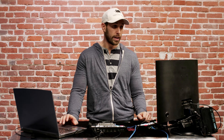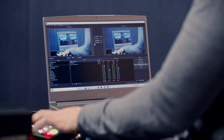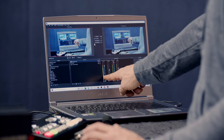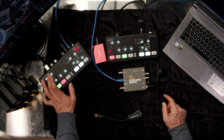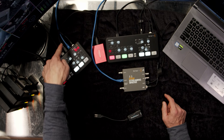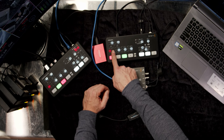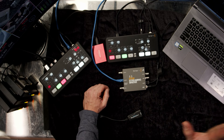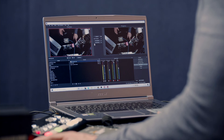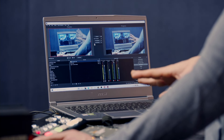One thing you might notice is that you're not seeing the audio come in. It does — audio comes through the Ethernet and into the device. All I have to do is simply activate that source, and there it is — the same mic coming in via HDMI. Audio and video via Ethernet — this is the future. If the source is off, you won't get any audio. You turn the audio on, bam — it's in there, synced with the picture. There is a little bit of delay, but in your final OBS presentation there is no delay.